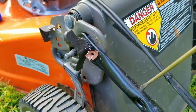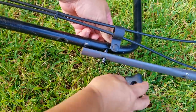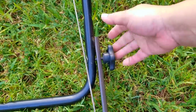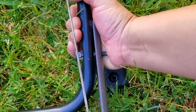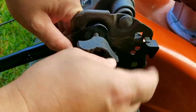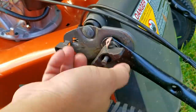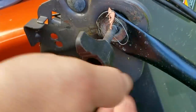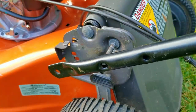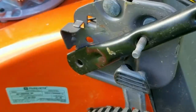The first thing we need to do is figure out if we relocate the bar to go through the next hole, whether we can then bolt the lower section in place to one of the two adjustable positions — otherwise we might have to make a new hole in the bar. I really only want to deal with the lower portion of the handlebar, so I'm going to separate the upper part from it and then take off the lower portion from the deck. The original design actually consists of two pieces instead of this single piece. I considered cutting this bar apart to make it more like the original one, but the one-piece design is more rigid, so I decided against cutting it. The other possible option would be to find another mower with a bad drive system and use it for parts, but these mowers are not very common since when new they were $400 plus tax. Once the handle is free from the deck I'll try to reinstall it, moving it up to the next hole in the bar — but it looks as though the handle is too long and it won't clear the bracket.